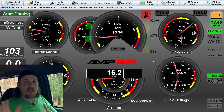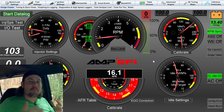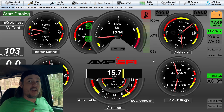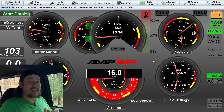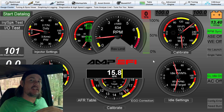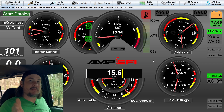Before any of this, on a setup like this we need to verify our timing. You can use your TDC and a timing light, but in our case the balancer had slipped because it's not pinned, and our TDC mark was off. So I ran a piston stop in on the compression stroke, ran it up until it stopped, marked it there, backed it off one turn until it stopped the piston again, marked it there, and split the difference to find top dead center.